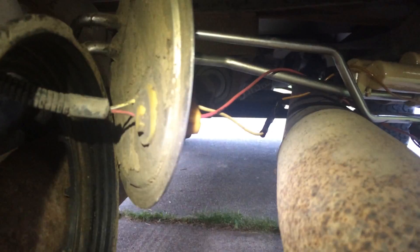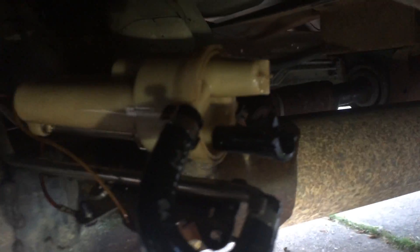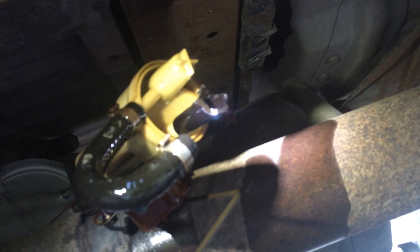I've got my sending unit out and it's laid up on top of the exhaust and driveshaft. Be careful not to bend the float rod for your fuel gauge. On the end of the unit you can clearly see where the plastic has actually broken off — right there, that piece of black plastic busted off. So that's where the new riser goes. Basically my fuel tank was just sucking from an opening about three or four inches off the bottom of the tank, which is why I was running out of diesel with a quarter tank showing — it wasn't pulling off the bottom.